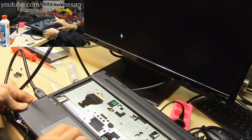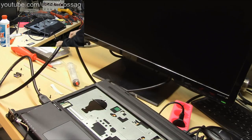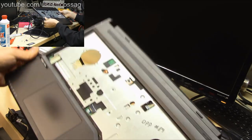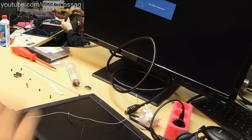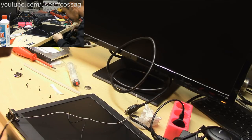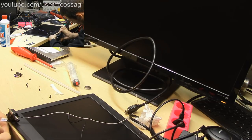Shut down. This thing is reasonably quick with an SSD, even though it's got a rather lazy CPU. And there we go, back to being powered down. So now we actually need to hook the internal monitor up again. Make sure the BIOS looks sane. There are a couple of settings that are really important, like the setting for always providing power to the USB devices. If I don't have power to the USB devices 24/7, I can't bash the keyboard to turn it on, and that is really important for this PC, since it's a bother accessing the power button.